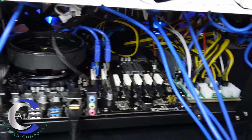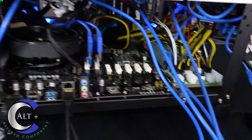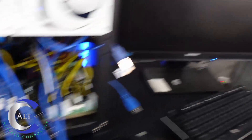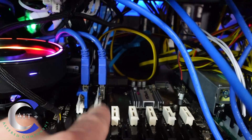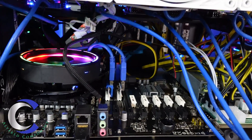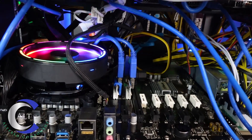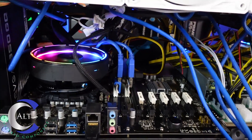The board's in place, Windows is installed, and I've updated the BIOS and changed all the BIOS settings. With just two GPUs plugged in, you can see the two green slots showing both are up and running. When I unplug just the riser but leave the clip plugged in, it shows up orange or red — indicating it's present but not initializing fully. That's a really neat functionality so you can tell when you boot whether you're having a riser issue or if the riser has gone bad and isn't fully detecting in BIOS. That's a really nice feature.